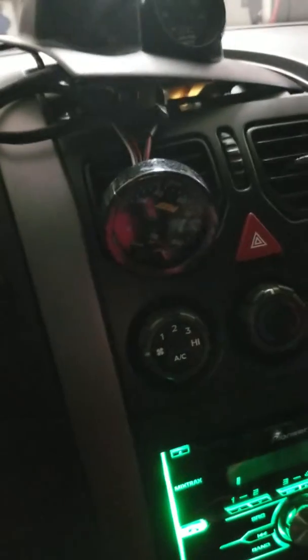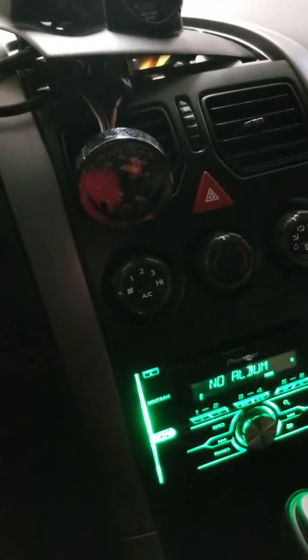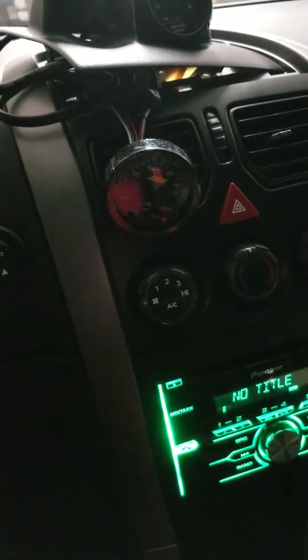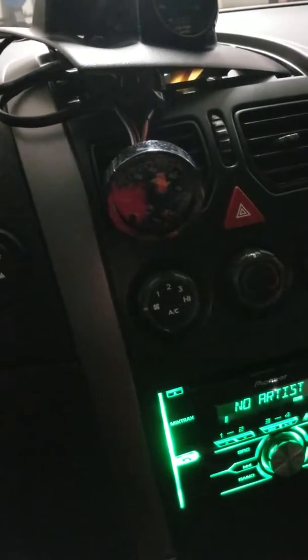This is the second gauge I've got from them. I said the gauge was bad, but I can't imagine two of them in a row are bad. I've back-probed all my wires. I've changed the 12 volts from the fuse box and got it jumped straight to the battery — that was their suggestion to see if that did it. That didn't work.